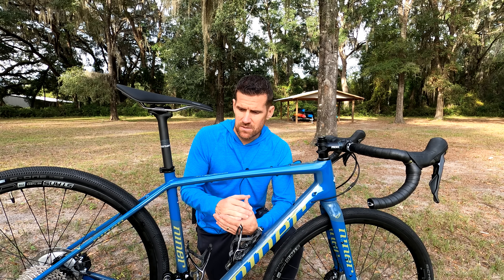Let's talk about the cable routing through the frame. I built this bike up from the ground up, so I had to run all the cables through the frame, and it's super easy. On the right side you've got your left shifter — your front derailleur cable going in there — and on the left side you've got your rear derailleur and rear brake. Niner also includes a port for a dropper post, should you want to run one on your gravel bike. Really clean cable routing. I pushed the rear derailleur cable in from the back, and there's a little plate underneath that takes a 3mm allen screw — remove that plate and it makes it really easy to get the cables through. On Niner's website you can find which hole goes to which port.